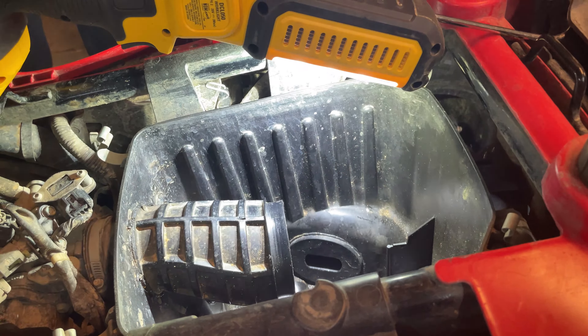Around the other side of the ATV, take the nut that comes with the kit and right here, screw it on — as you can see here. This location is where your resonator box was. Make sure you put silicone on the lip of the nut and on the lip of the screw on the other side, and that will keep everything watertight.